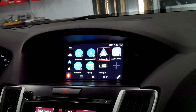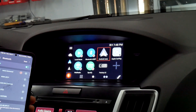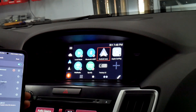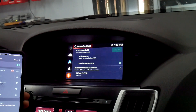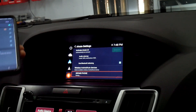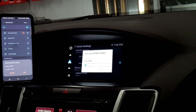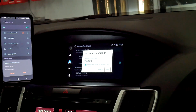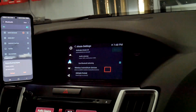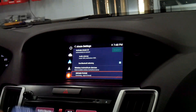Today I'll be showing you how to pair your Android phone to Android Auto. First, open up your phone's Bluetooth and make sure it's scanning. You'll see the V-line — select Android Auto. Your phone will pop up on the bottom of the list. Select the phone, and both the phone and the V-line are going to get a pairing request. Make sure you allow access to your contacts and call history, then press pair — and do the same on your phone.